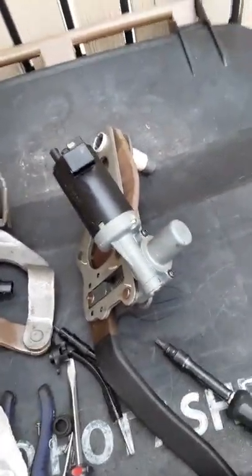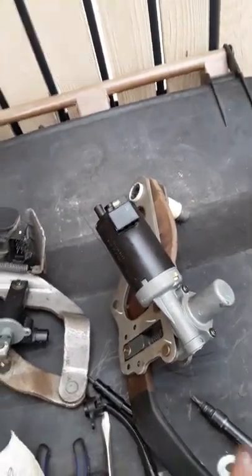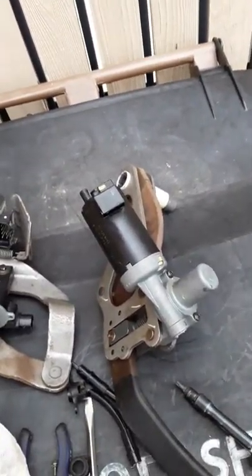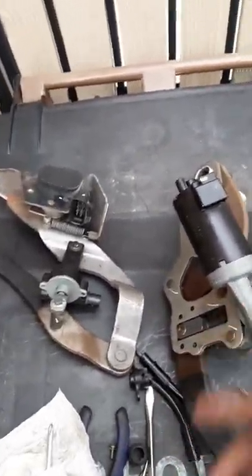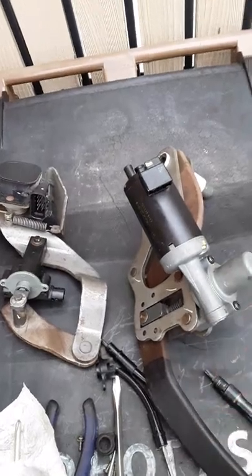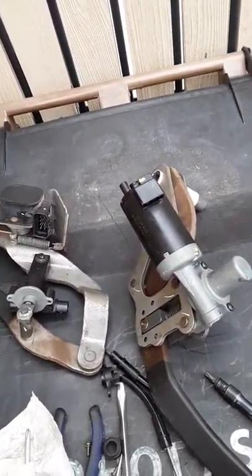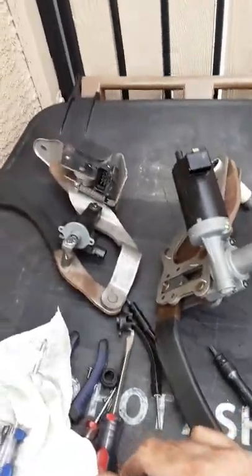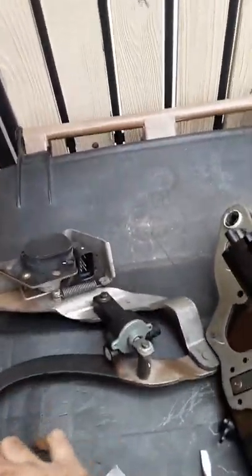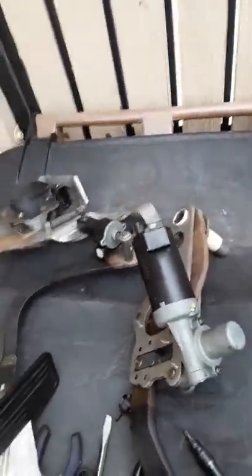Now if you have a broken cable, it's the same thing — under the little clip on the very top under the rubber mat. Pull it out, put the new one in, drop it in, and tighten it up. When you do the cable, though, you want to make sure that your pedals are adjusted all the way out before you do it. That way when you adjust them, they're equal. I hope that helps you guys out substantially, because my frustrations in this video will hopefully make your life a little bit easier when it comes to fixing the pedals in your Chevy Suburban, your Denali, your Yukon.